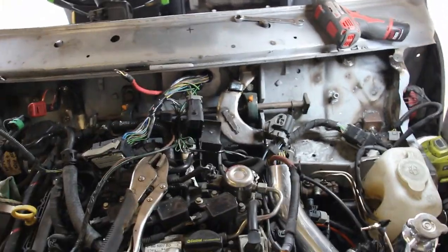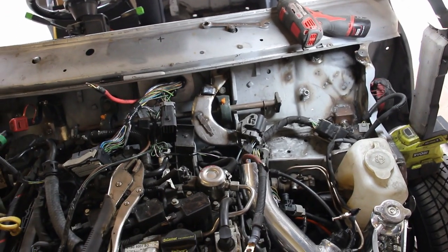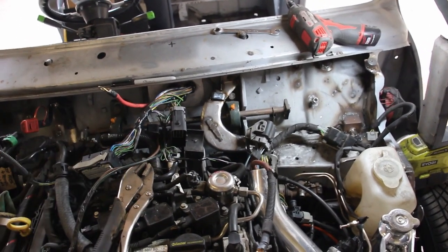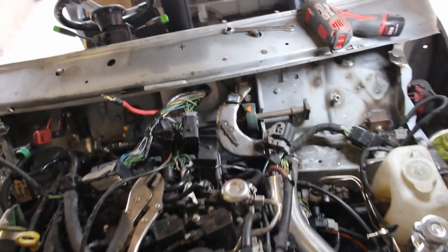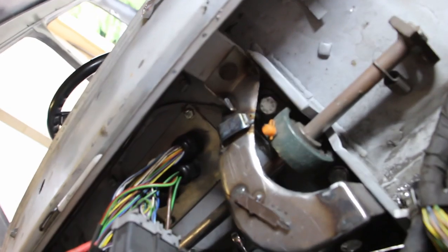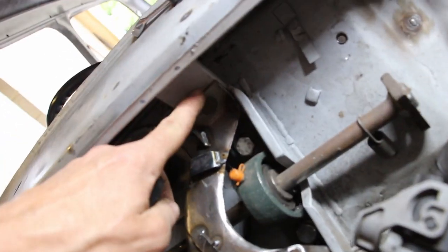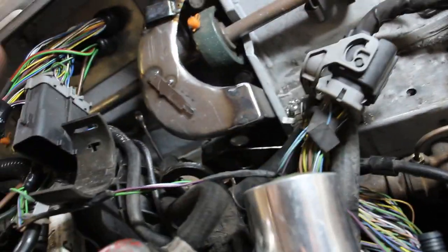I just can't get down there, as you can probably tell, even with the new bracket above it out of the way. Might need to put a little plate behind it, might just weld it on, but I've only welded it on one spot at the moment. Top plate here, this curved section, she's in. M8 bolt at the top, M8 bolt at the bottom. I have welded in a nut behind this plate and welded a nut down here on this plate, so it's just a case of putting two bolts in.